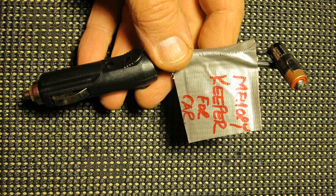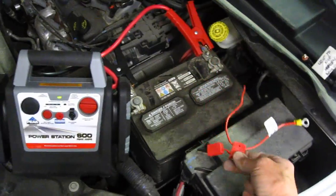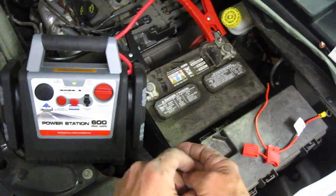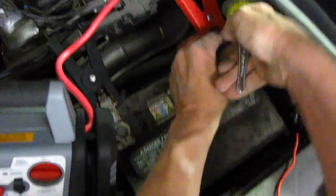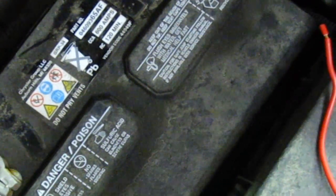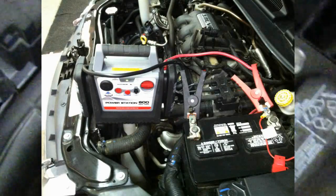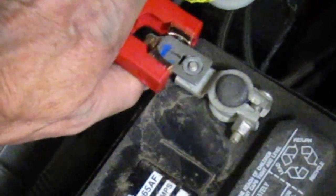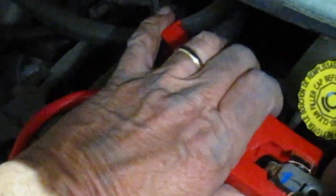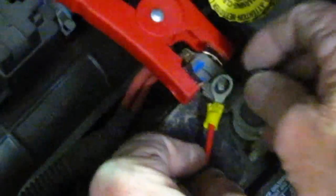The way to do it is just hook up another battery — a 12-volt battery — to your setup. I've even made one that I can plug into my cigarette lighter and do that. But in this case, I'm putting an adapter on here for the harness for a trailer hitch that I just put on. You've got the 12-volt battery hooked up here. All we have to do now is loosen this bolt — I can unhook this whole thing — and I've got 12 volts there. As long as that 12 volts is on there, I'm not going to lose my memory.